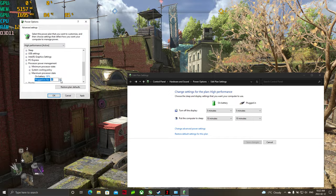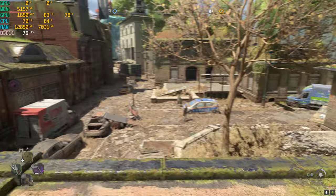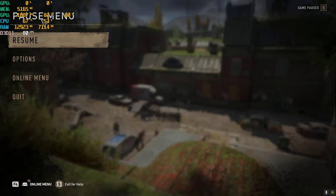And then I'm going to go back and change the other one down to 97. So we were at like 92 celsius before. We lost about 5 FPS but you can see right there I'm down to 70 celsius. You can keep messing with that and try to find what works best for your computer where you are getting the FPS you want and around the temperatures you like.